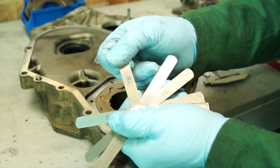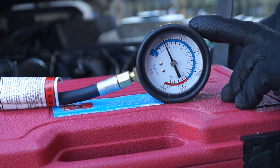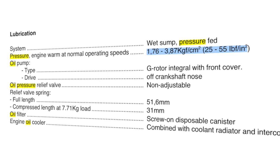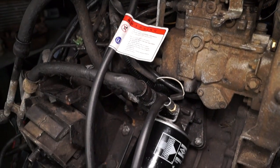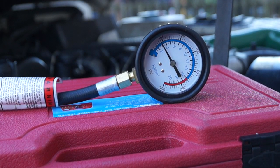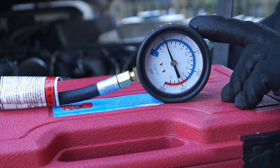We're going to do some measurements to see if it's okay. Ideally, first of all it would be better to check the oil pressure with the engine running before stripping, but unfortunately in the real world it's not always possible. The workshop data will tell you what the pressure should be at normal operating speeds. It would be advisable before you take the engine out of your vehicle, or if you go and buy one, to check the engine oil pressure — this will save you a lot of time. Get the engine to running temperature and then check the pressures.